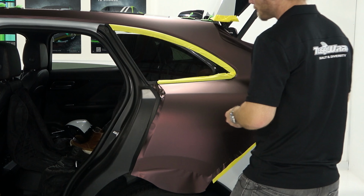We don't have to do the door area yet. Let's start doing the rest over here. So let's push this up and under the trunk or the hatch. Cool. Let's take this, and this is going to have to come this way. So all I'm going to do now is separate the top and the bottom area. Now, I didn't mask off the window, so be careful with your knife. If it's sharp enough, it can scratch the glass or any black plastic trims and so on.